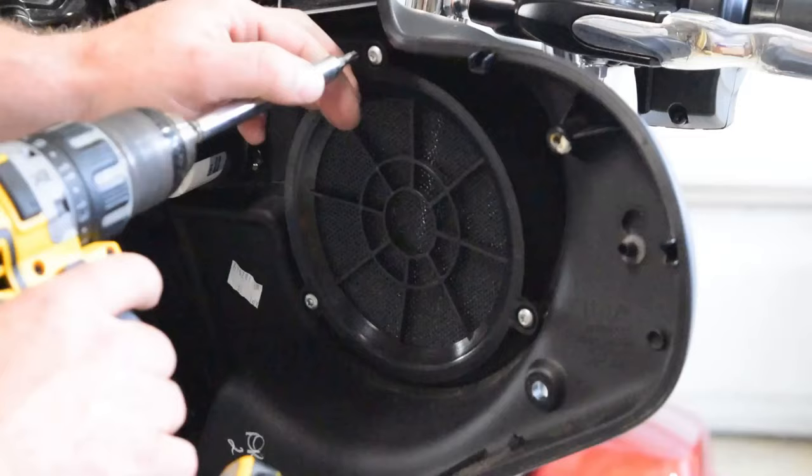Before I stick the amplifier on here, I'm going to go ahead and get these self-tapping screws I'm using pre-drilled in there. Make sure that the holes are good. I don't want to have it actually drilling this hole that I already made. That hole right there, I don't want it making that hole larger, and while doing that, snag one of these tabs on this amplifier and tear it up. So anyway, I'm going to go ahead and pre-drill this with this, and then I'm going to back them out, put the amp in, and then snug them all down.